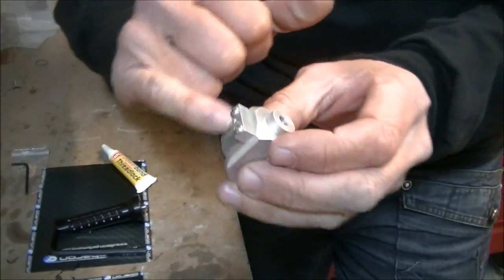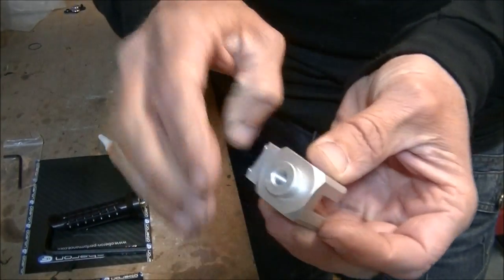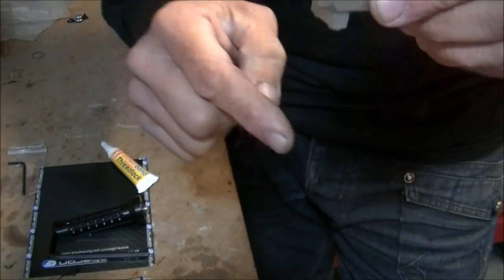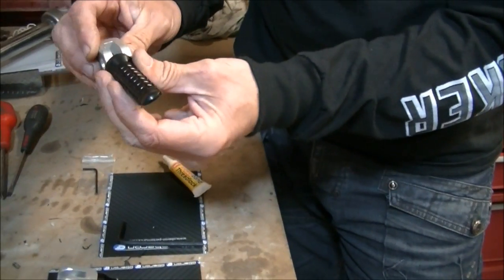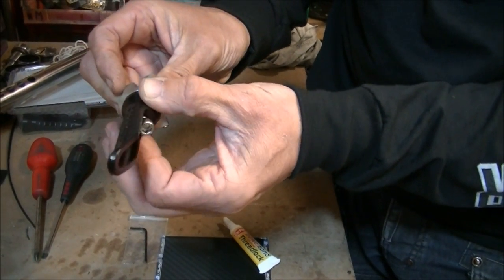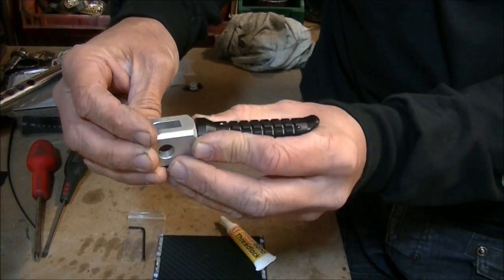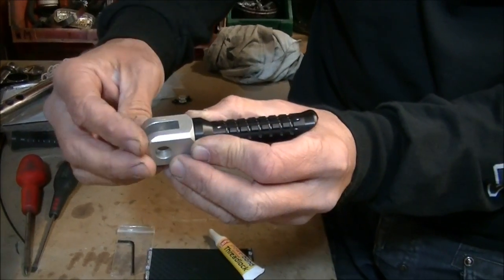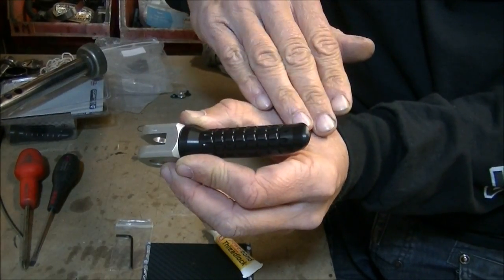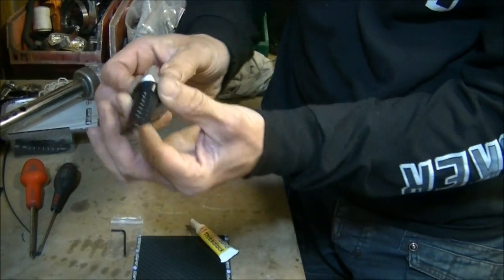This little post on the bottom is the stop — it recesses down into the actual clamp and stops it going any further, so that's got to go at the bottom. When you fit the thing, you've got to fit it so that the stop is angled at the correct angle. Because on this bike, the rear pegs lift straight up, but the front pegs — in order that they don't catch the ground when you lean the bike right over — they lift slightly backwards. So you have to rotate it correctly. I'll show you how in a minute.